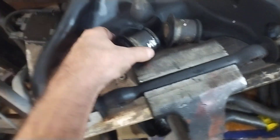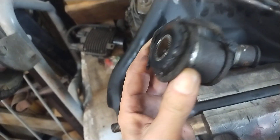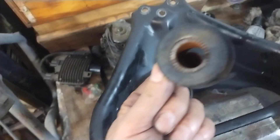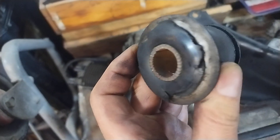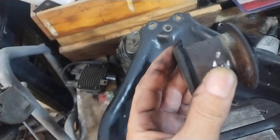I already knocked the control arm bushings out. You can see how oil soaked they are — it just ripped. I felt sure I heard the rattle; that rusty condition could have been the cause. You can see they're just gone. The other side looks the same, though the upper on that side has already been replaced.